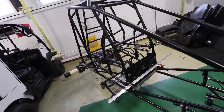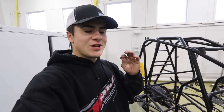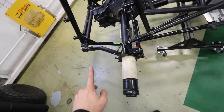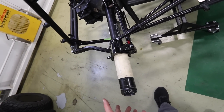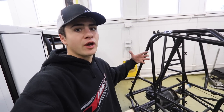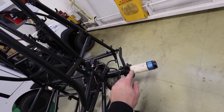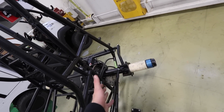I got a pretty solid smile on my face because another part of the building process is done. I want to mention three key things worth noting when squaring a rear end that you've got to make sure are done, or things could go south. The first one: you've got to have some assortment of spacers to hold your bird cages all the way in past the splines, otherwise as you're connecting and disconnecting things they can easily slide off. Once they slide off it's really hard to get them back on especially if everything is already together. Even if you're just changing bars at the racetrack, it's smart to do this because if those slide off it's really hard to get everything back together.